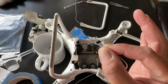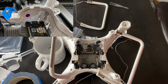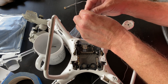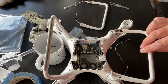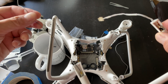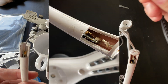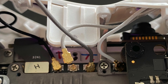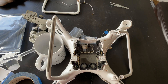I had initially labeled one of my wires to help me get back to the beginning again, so we're going to take this label off and transfer it onto the same cable going into that slot — saves a lot of frustration later trying to remember what we did. As you can see from the old part, this one was still here and this was the broken side. This one is a lighter gray versus the darker gray, but with the new part they're both the same color. I kept the old parts, which is always a good idea, to retrace my steps. The new missing part goes back on that side, and we'll continue routing.